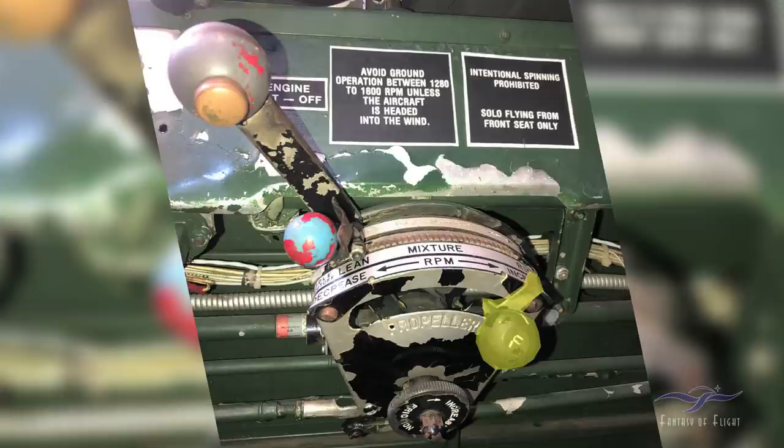The little black knob in front — it should say 'P' on it — is your propeller control for the constant-speed prop. Full forward puts the propeller in fine pitch for takeoff. Once you're at cruise, you bring it back. Full throttle is up to the red line and once you start cruising you bring the RPM back. The prop changes pitch through the governor depending on whether you're climbing or diving.